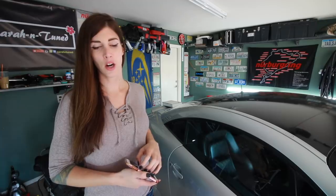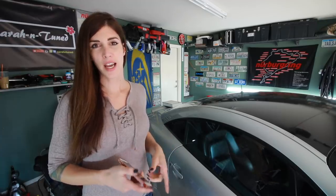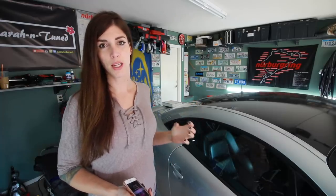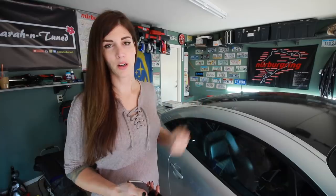I did a little bit of research on the cooling system in this car, and basically there's a high and a low speed for the fan, and because my fan keeps going high, then nothing, and then high, then nothing, it's because there's no low speed right now on my fans, so the computer is trying to compensate by going high speed, then off, then high speed, then off.